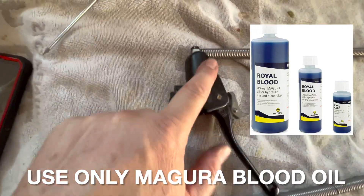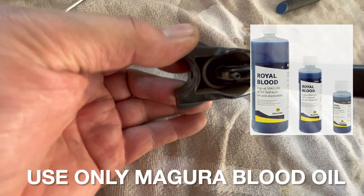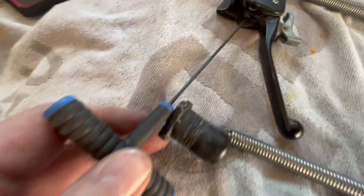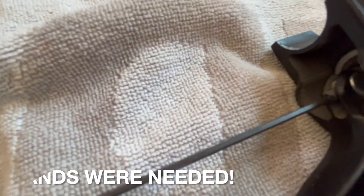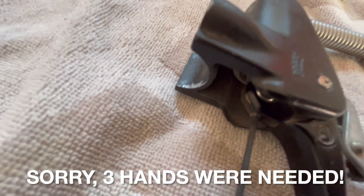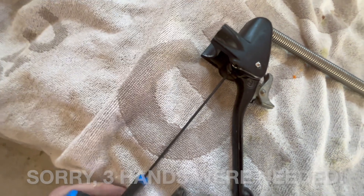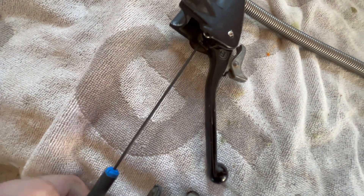Master cylinder, slave cylinder. The first thing I suggest doing: there's a little set screw — you can see it right there — this is a two millimeter set screw. If you tighten this, that increases pressure in the line. So take this and go underneath the handle; it's on the side and underneath the handle. If you tighten this, it'll tell you if you have any fluid whatsoever in the line. Tighten it — you can go almost to max — and then pull your clutch lever.